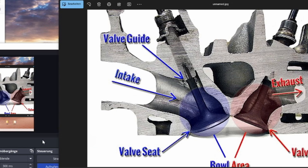This is what you have to watch out for if you are enlarging the port, and this is what a lot of people do wrong — where they overdo things even when starting out with a slight head porting job, saying they will do a stage one head port and make the inlet of the port a little bit larger on both the bottom and the top. What you actually want to do in theory is make the angle steeper, like I showed you before. So you actually want to take material off only the top, not the bottom, if you are trying to make the ports larger.